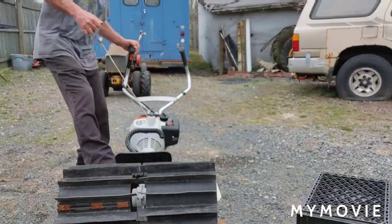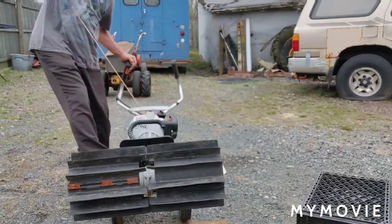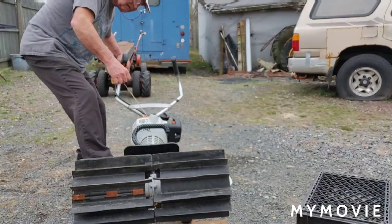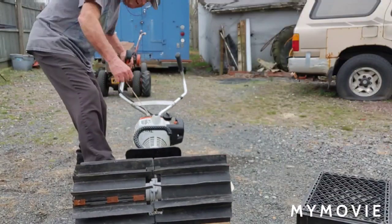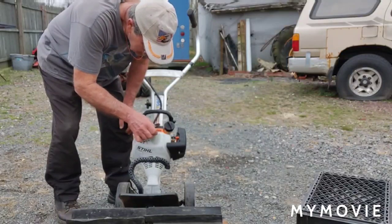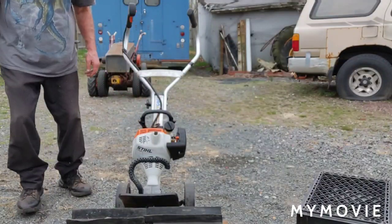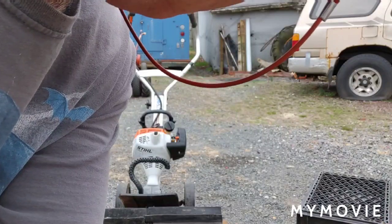The pull cord seems to be really short. I think he said it started — let's see what's going on. Give it some throttle maybe. The throttle seems to be working. Maybe I'll pull the spark plug out and see what's going on. Looks like somebody punctured the spark plug. I don't know if it's all the way through or not. Actually, I had the on/off switch in the off position, so I doubt it would have ever started. I caught that before I even bothered to pull the spark plug out.